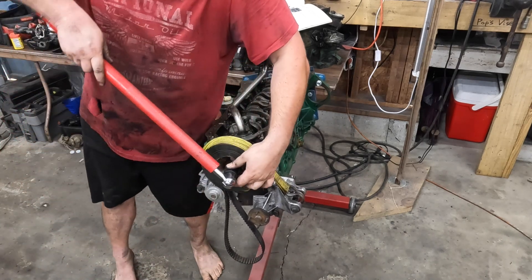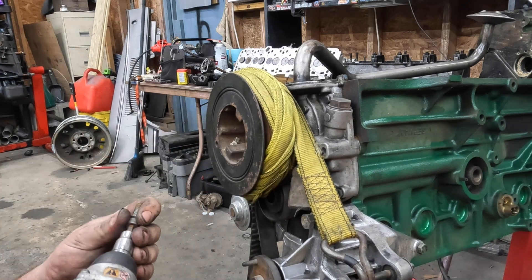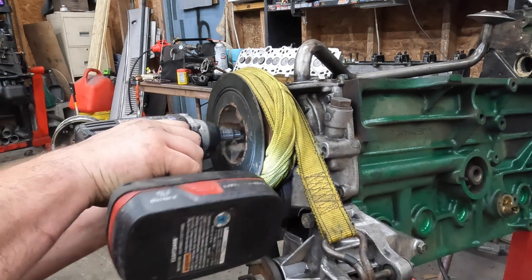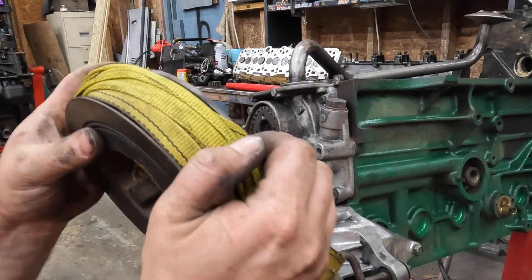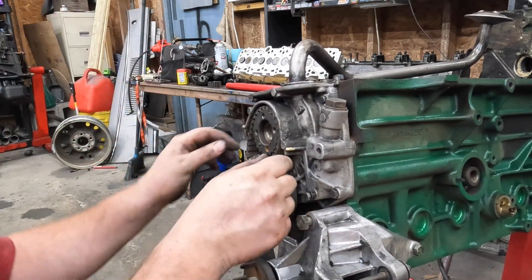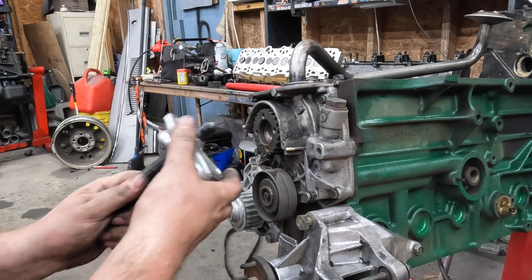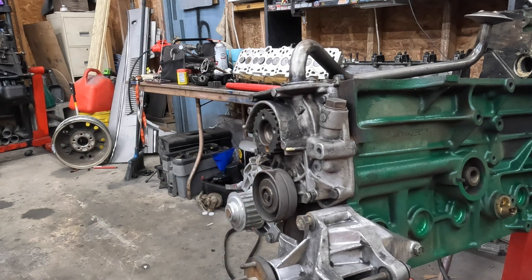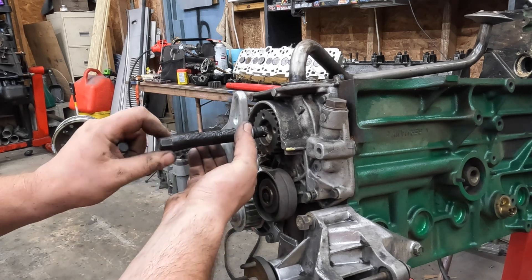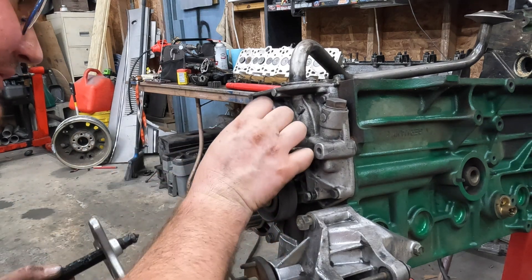No satisfying pump, but it's coming loose. Now with that big bolt out of the way, there are just four hex keys inside here. This dampener should just slide off or tap off with a mallet — nice and easy. Now we can get to our main pulley. This is one of the very few times you'll actually hear me recommend using the proper tool for something, because trying to pry this off with screwdrivers, you will absolutely break it. My puller seems to be too small. Let me find something — I have found something to make it close enough to the right size.